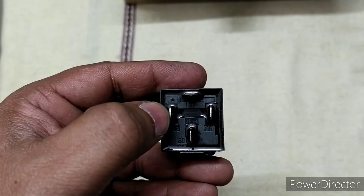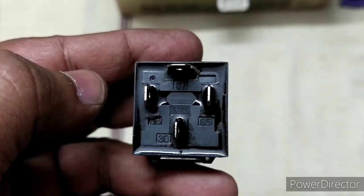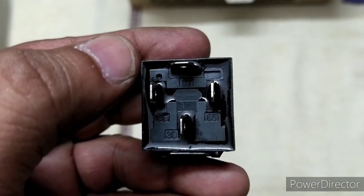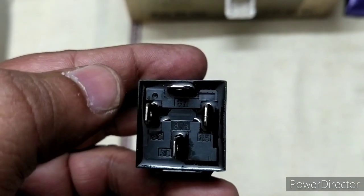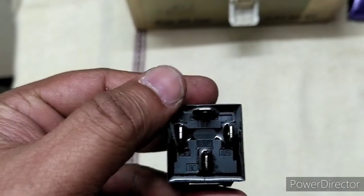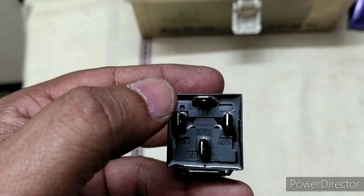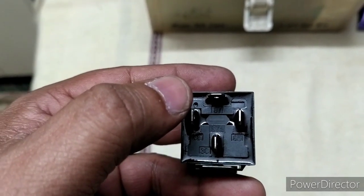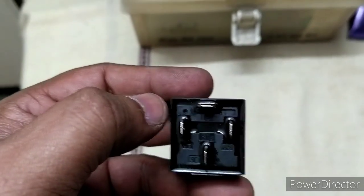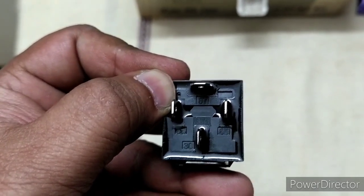The other two vertical pins, 85 and 86, will help make or break the circuit. Regardless of which side you put on the positive of the switch, it doesn't matter. Pin 30 goes directly to the battery. Pin 87 goes to the positive of the fog lamp. Pins 85 or 86 go to the switch for the aux light, and the power source comes from the Honda AUX socket. I am putting a diagram of how the wiring has to be done.